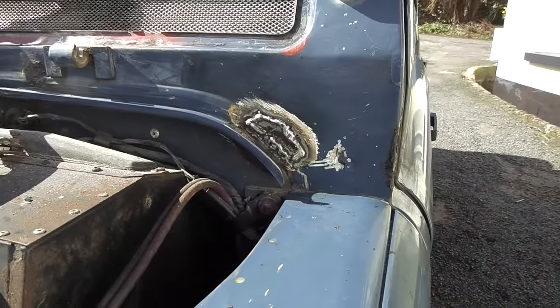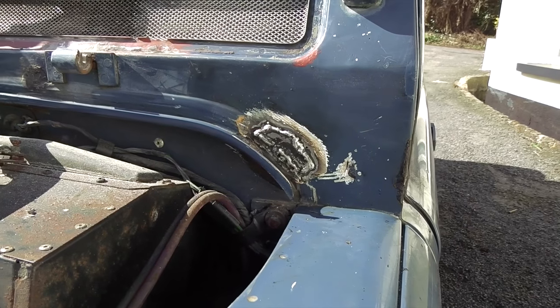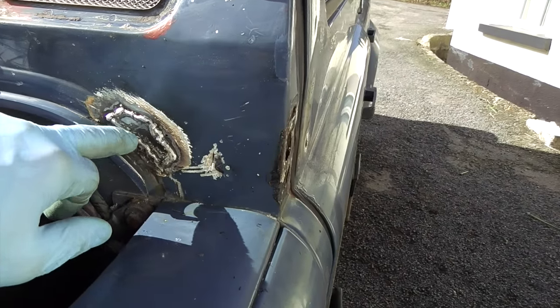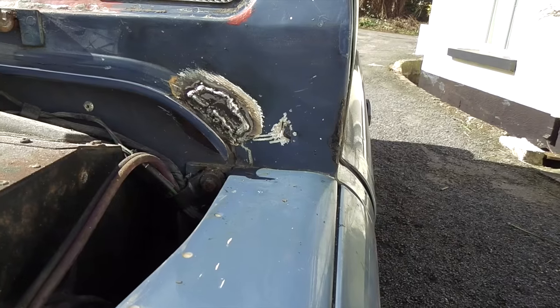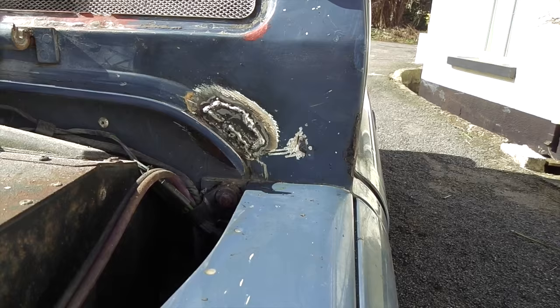The hole is now plated — not the prettiest of welds, it's quite awkward to do because there's a bit of sealant around this area which kept spitting. I thought I'd ground most of it out, but it's stronger than what was there and hopefully it will stop the leak. I'll cover it in some red oxide in a second and repaint it — you won't see much of it anyway as it'll be hidden by the bonnet area.